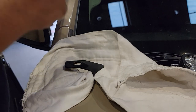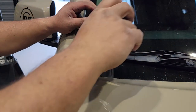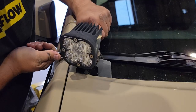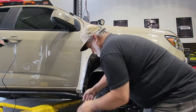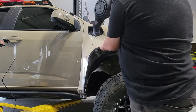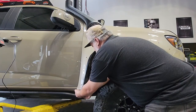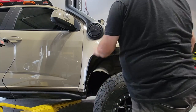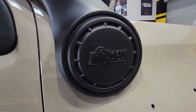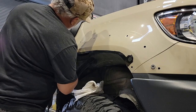Use a flat blade to tighten the bellows in place and ensure there are no air leaks. Now that the hood is down, readdress the ditch light issue — grind out about a three-sixteenth to quarter-inch slot into the material so the Baja Design Squadron can be reinstalled oriented in a way that doesn't hit the snorkel. Now at the final phases of installation, all the prep should make this a really easy drop-in. Start with the bottom, pull the fender out so the snorkel drops in easily, paying attention to where the outlet meets the intermediate tube and where the two holes on the A-pillar line up to the snorkel. Everything fell into place, so push the inner fender in and check that the tab lines up.